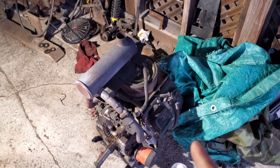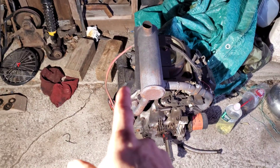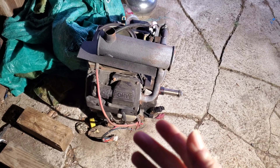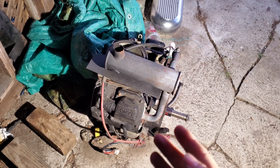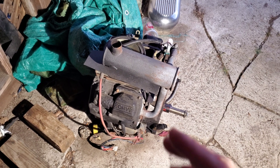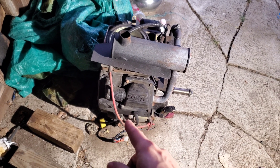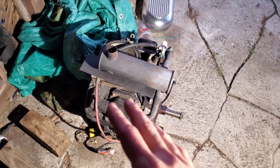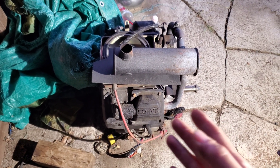On these Kohler Command V-Twins, some of them actually have a different style ignition system, but it's still a magneto. Some of them have an ignition control box mounted on the outside of the shroud - it's a black square box. They're actually very prone to failure, and when you need to repair that, they will sell you regular replacement magneto coils - basically a kit to eliminate that control box. Even with the control box, it'll still have a ground-out kill - it's still a magneto. So you'll still get your tach signal from the actual harness portion coming out of the engine. The Kohler V-Twin underneath looks basically the same as the Briggs.